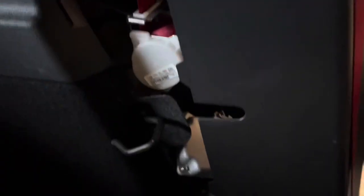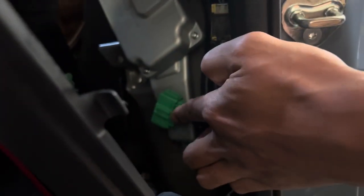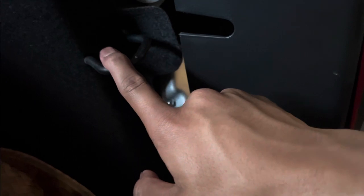I can see the module right here — let me give you guys a close up. Pull this and it's right here. There's going to be a big green connector right there — that's what you're going to want to unplug and put it on the new one. It's held on by two 10-millimeter bolts. There's one down here and the second one up top. You'll just reuse the OEM hardware.